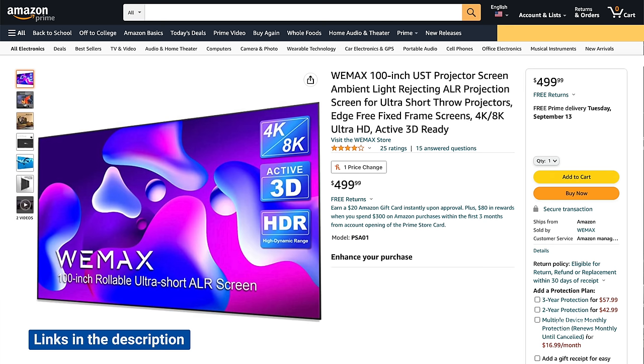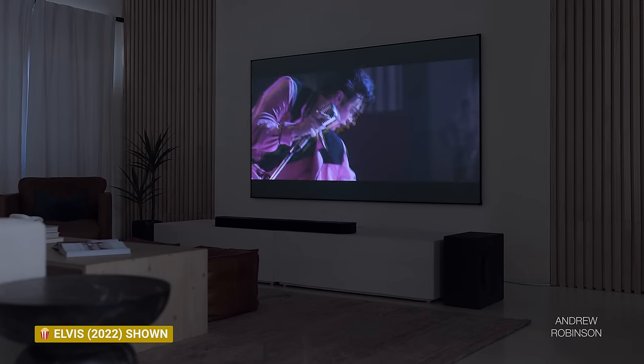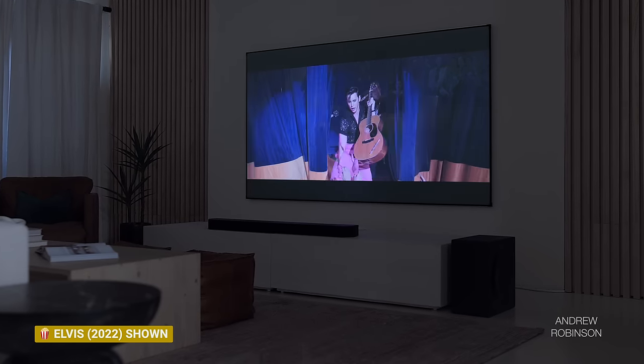Let's really dive into the Premiere. Before I jump into any measurements and results, know that your room, your choice in screen, and ambient lighting conditions are all going to play a role in any projector's figures before and after calibration. For example, our new screen has a negative gain of 0.6, meaning our light output figures are going to be roughly 40% less than if we had a unity gain or positive gain screen. We went with the negative gain screen to achieve better black levels, contrast, and clarity when viewing in ambient light, something projectors like the Samsung advertise you can do.